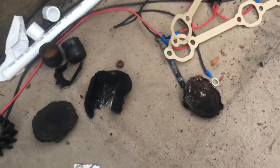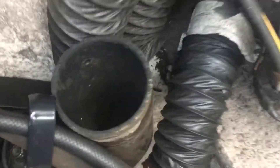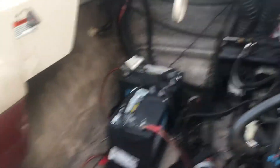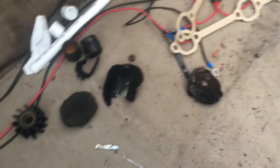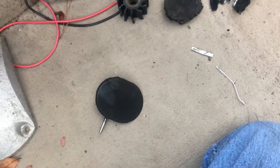This is what's called a flapper — a flapper valve that goes in the exhaust. It goes down that hole right there, and there's another one on this side that goes down that hole right there. You can see the hole where the pin goes. This was a good flapper that was left in it, on that side of the engine. But I found a technical service bulletin from Volvo that said to take these flappers out — that they're not required — so it recommends you remove them. So I did.